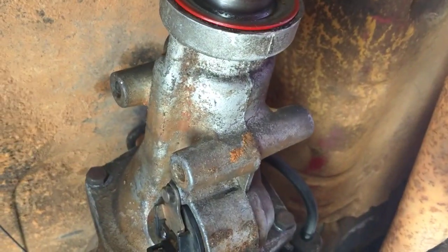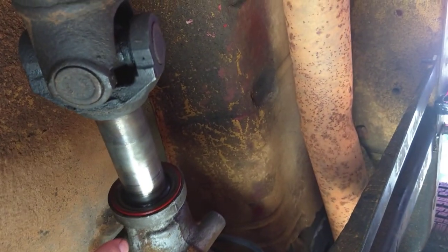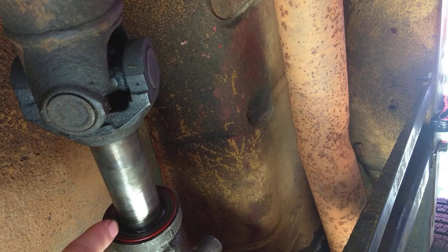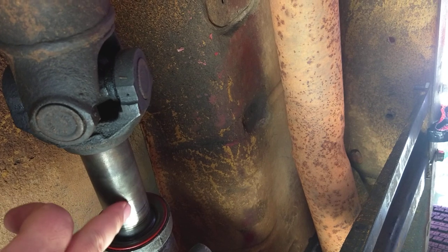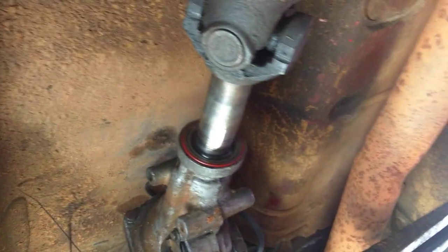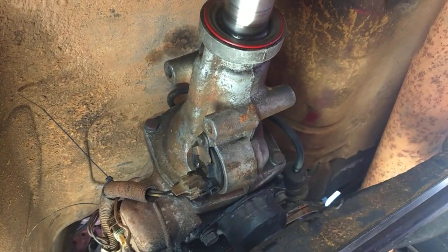To me it just seems like a lot of excess yoke sticking out. If you take the driveshaft out, the splines coming out of the rear of this transmission are actually protruding out quite far. So the yoke is sliding on there, but it's only in about an inch — because this thing is about six and a half inches long. The trans shop told me most yokes coming in these trucks are about four inches, but as you can tell, that's longer than four inches.